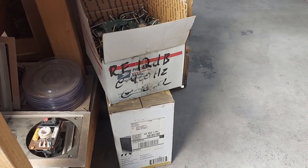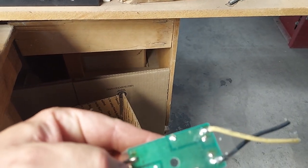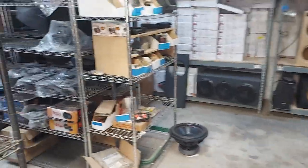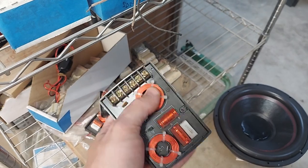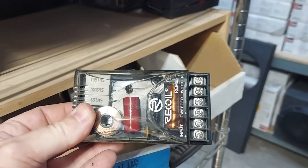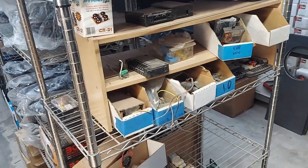These are Rockford Fosgate MX128 crossovers — 12 dB at 47 microfarad. So that's probably 8 ohm 12 dB, and I think they're at 5k — 8 ohm at 5k is not very popular for car audio, which is probably why they were left over. We also have passive crossovers: this is the original Hard Times crossover which uses air core copper inductors and a simple cap, with tweeter options. I don't have many left. We've been using either the Recoil crossovers at 3,500 Hz or some other crossovers. I don't really recommend passives.